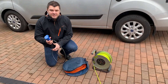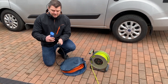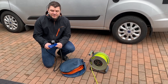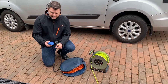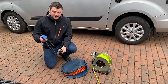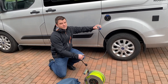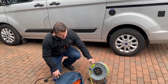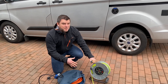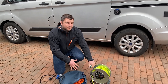This is the voltage left on the auxiliary battery. This is ascending at the moment because it's charging but normally would be fixed. It's warning me that there's no water in the tanks. This is the time and this is the outside temperature. The Ford Nugget comes with this lead to connect to the mains. In the UK, we have the three-pin end and this is the standard European CEE 17 connector. I'll show you how that connects to the van in a second, but before I do that, I'll just explain what we've done.